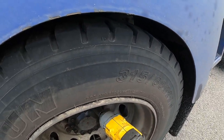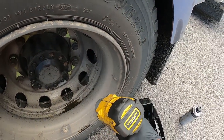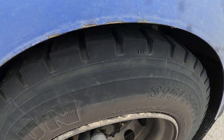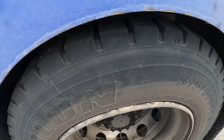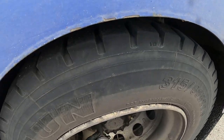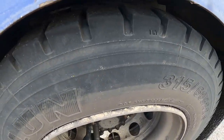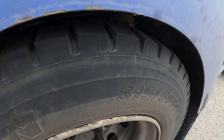Fortunately these Volvo half shafts have no puller bolt, so it's a case of giving it a bit of a whack with the sledgehammer. There are little collars behind the bung, that's what normally stops the half shaft from coming off easy. They seize on, the water gets behind them. They're a little bit rusted up now, but it might not be too bad. It's not a very old vehicle, this. Depending if it's broken down, it's been off before.